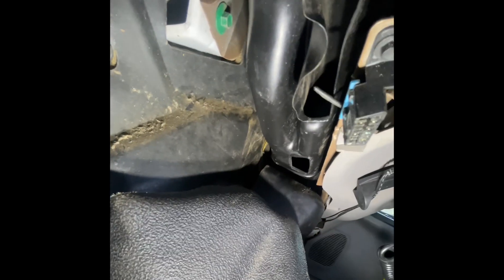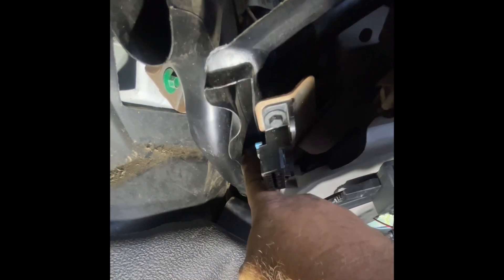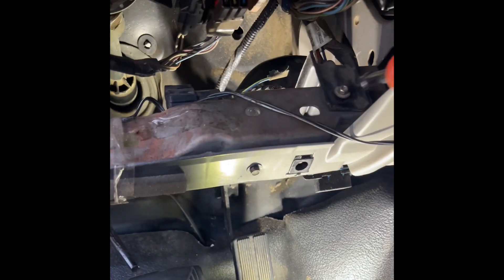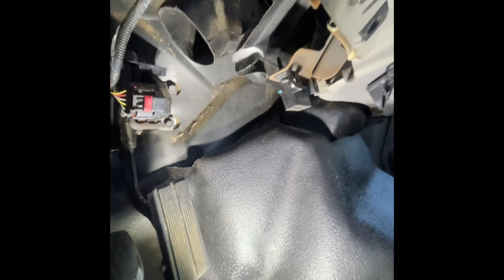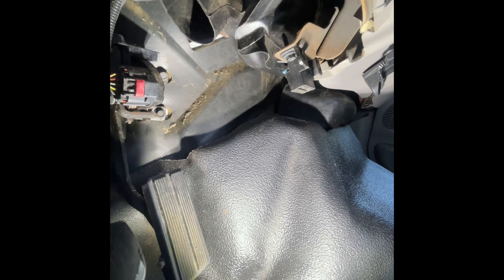It's back in. Get the vent back in — there's a bracket, there's a vent going all the way back. It goes in right there and just kind of dangles. You will need a 7mm to take this screw out. Once you pull that off you pull the whole thing right out and you can get up behind that to get to the flasher — easy peasy.